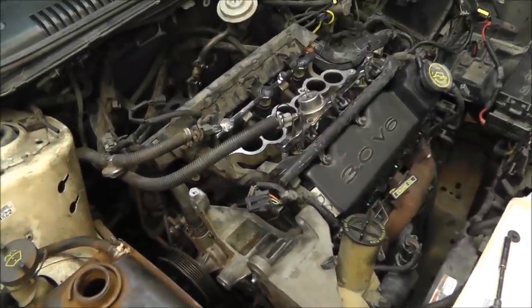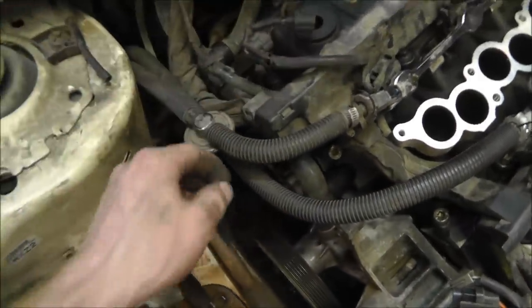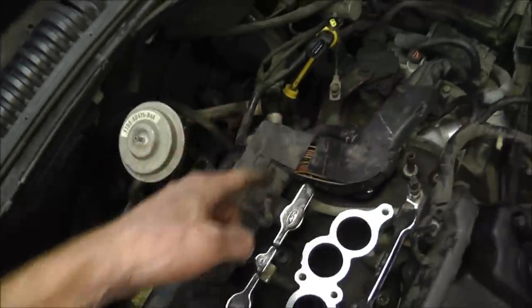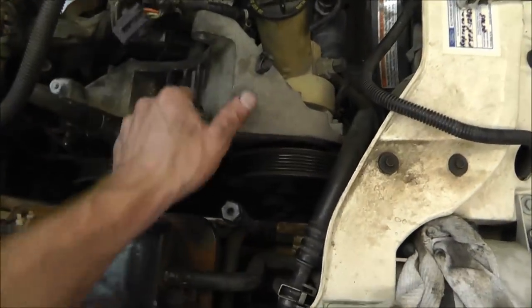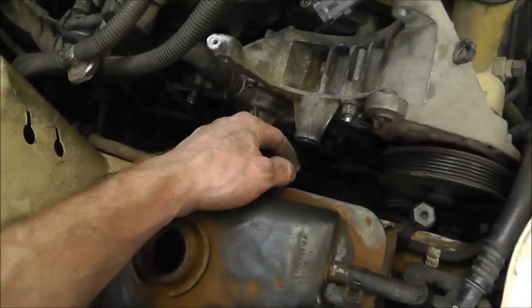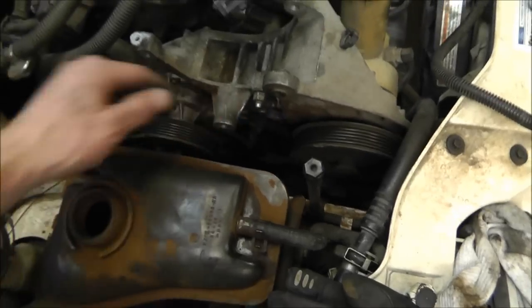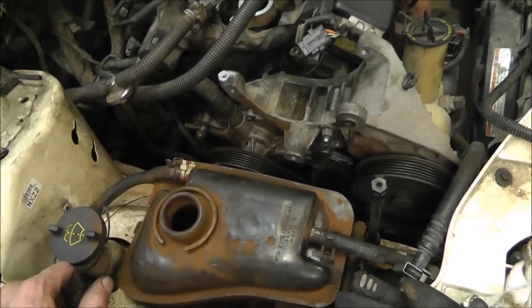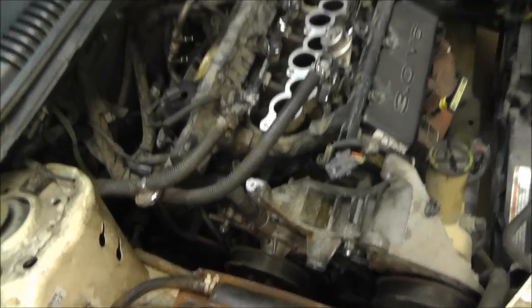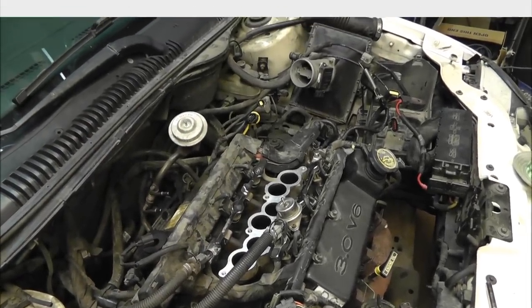Alright, during some of the hoses that I put on, I had this on top of this wire harness. This wire harness has been a pain in the butt for me. And I had to pop it off here, luckily, and just pull it under. Went ahead and put this hose on and hose on over there. And then I went ahead and bolted the pump here on. And next I'll be installing the pulley back on here. And I should be able to put both of these pulleys back on. I'll go ahead and definitely put the tensioner. And probably that's it for now, and I'll go ahead and install the intake manifold. Off we go. It's getting later and later.